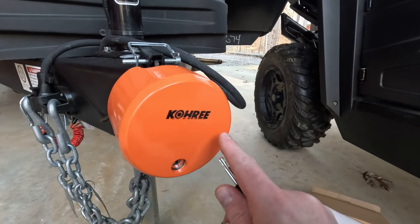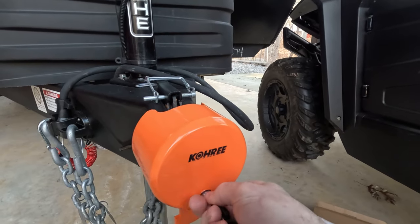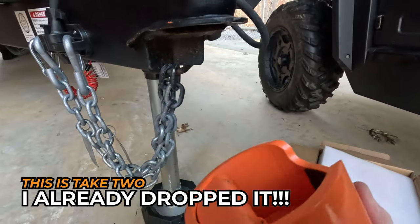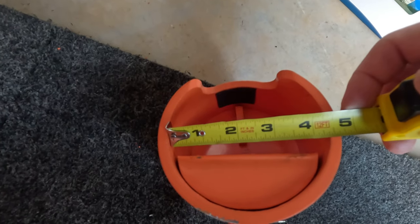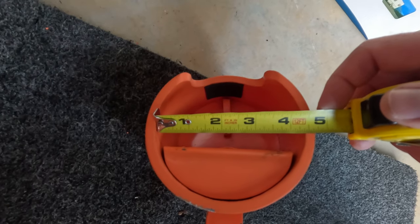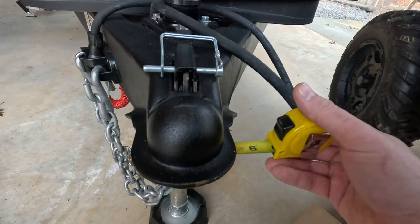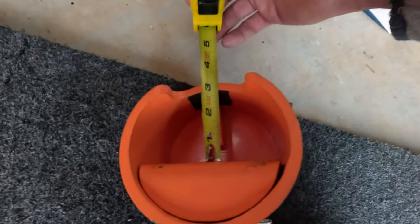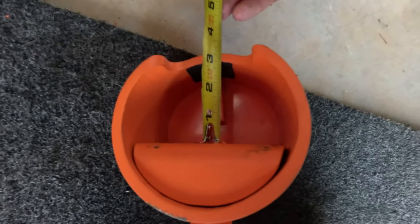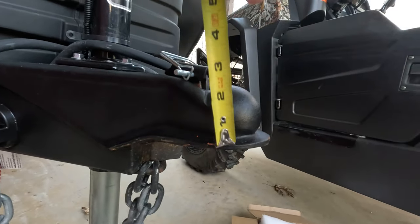Let me remove this and give you the dimensions on the inside of the lock so you can see if it'll fit your particular A-frame trailer tongue. The key comes out really easily. It is really heavy — pulling it down here. So the dimensions inside: four inches and three-eighths across the widest part, so measure across the widest part of your coupler to make sure you can clear four inches and three-eighths. The height between the lock mechanism and the top of the lock is two and three-fourths inches tall — that corresponds from the bottom all the way up to the top of the ball.